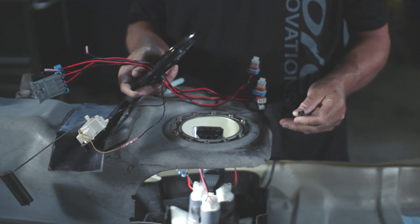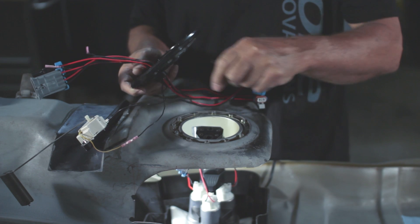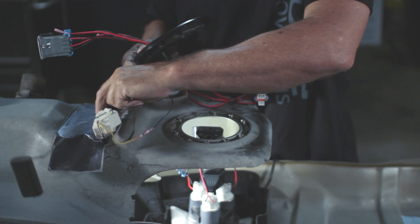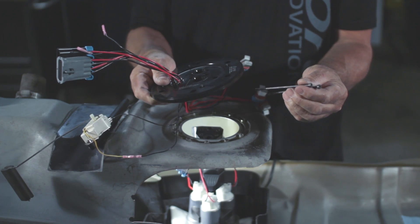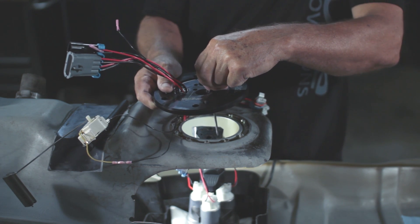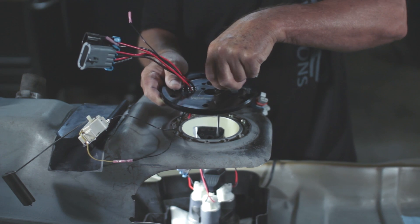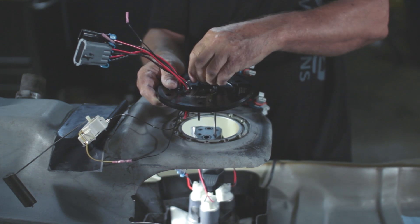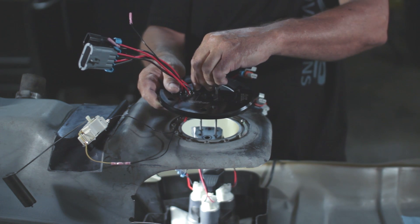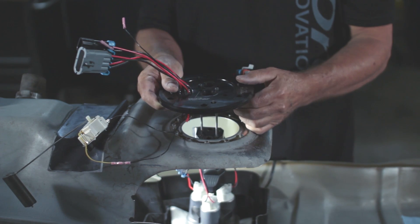Now that you understand the orientation of everything, pay strict attention to the six O-rings on the lower assembly and also the O-ring on the end of the level sending unit — if not, it'll leak. We've provided these long bolts to extend through here and these are required for your assembly. Slide them in and give a few turns, putting two of them in. At this point, you may want to get an assistant to help connect the wires, as you'll be lifting the module up out of the tank somewhat. Make sure you are clearing the wires of the level sending unit.